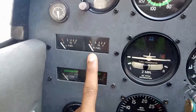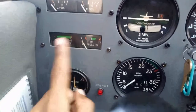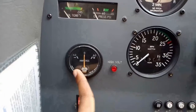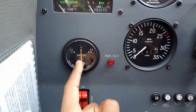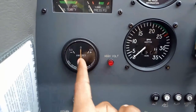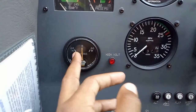We have the fuel indicators. We have two fuel tanks, one in each wing. We have the oil temperature and pressure — just to monitor if the engine is overheating or if something's wrong. To the left of that we have our ammeter, which shows if the battery is discharging or charging. If it's to the right, the battery is charging; if it's to the left, it's discharging; and if it's straight down the middle, then nothing is happening, like right now.